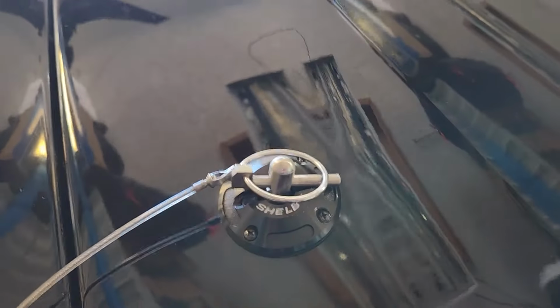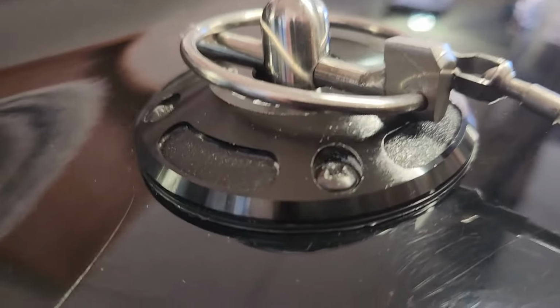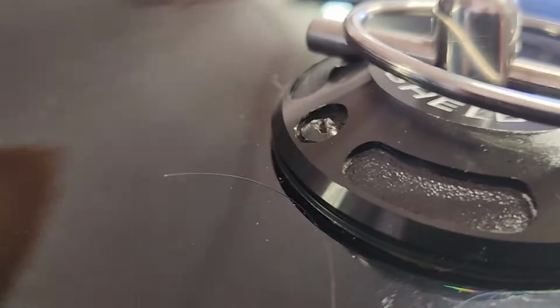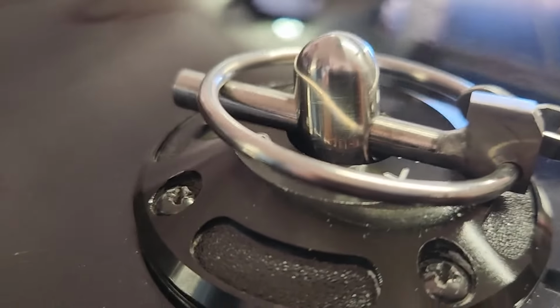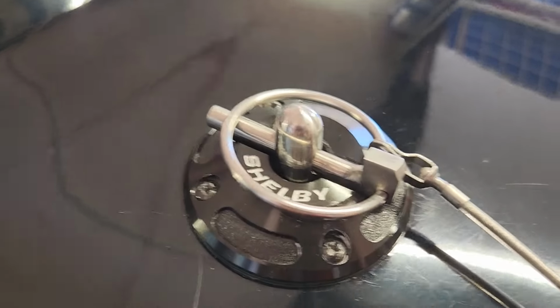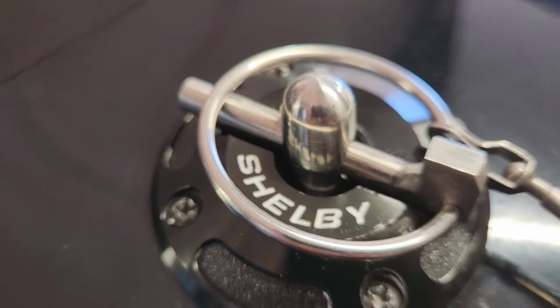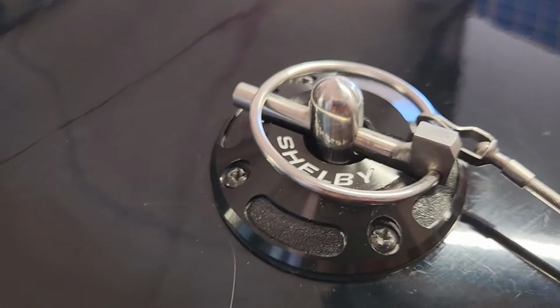But when you get the pins redesigned with the 16-degree cut in it, it lays in the groove exactly the way you would expect it to lay in there. And it looks beautiful. Look at that. It's a perfect fit. 16-degree angle is what you're after.